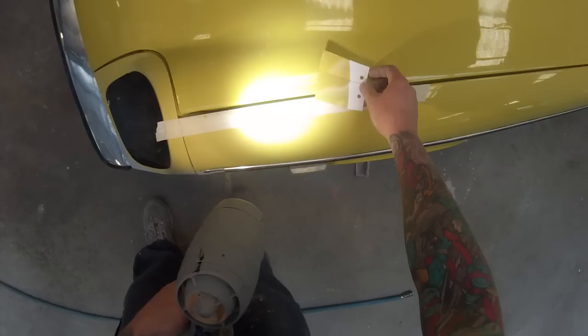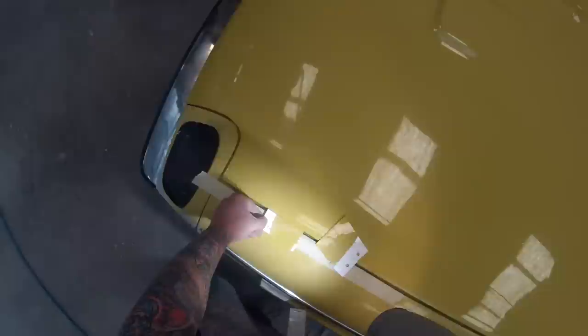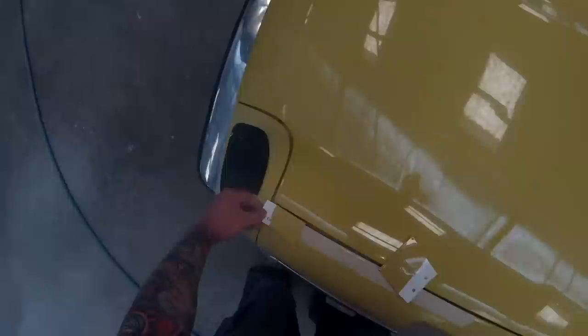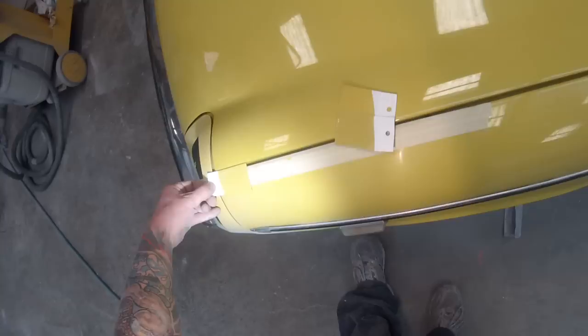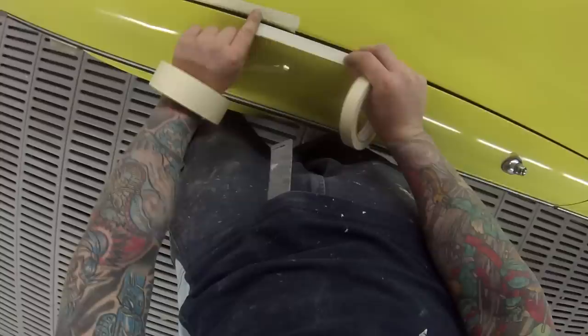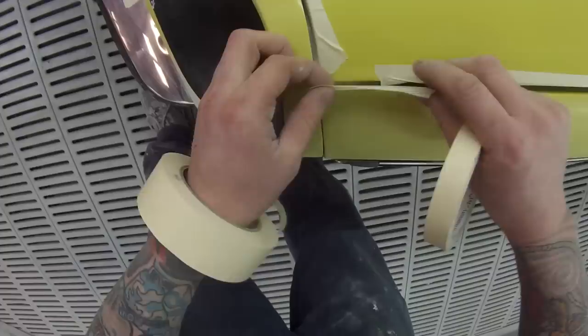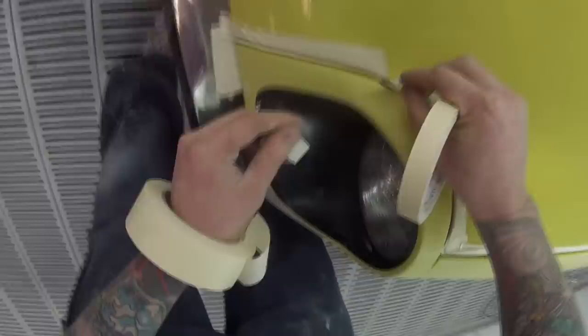This is the final look at the colour — it's really come along nicely. With two changes from the original we were able to get a really nice match. To get that colour I used the Standox spectrophotometer, which takes three photos of the paint work, then you plug it into your computer and it scans the database against every single colour. It can suggest a better match than the listed Jensen colour code, and it'll also shade the colour — adding or removing tints based on what it reads from the photo.